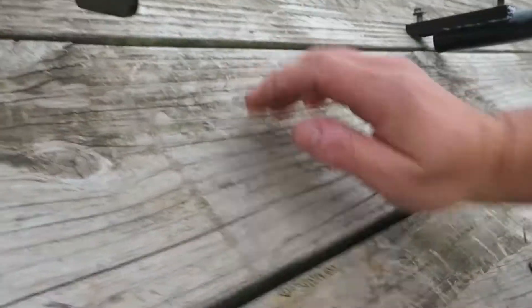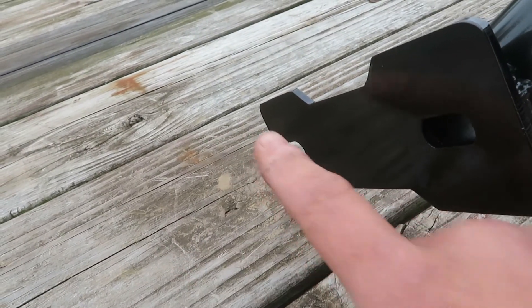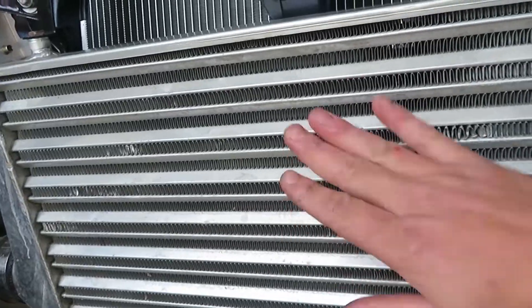The hole here is slotted and the back is slotted, so you actually have some in-and-out movement. That just happened to be enough for me to clear my intercooler with just a little bit of tweaking - extremely happy about that. But that is something to note: if you think you have a really thick intercooler setup, or oil coolers mounted in front of your intercooler or something, just consider it. Due to the slope of the bash bar the jack point is going to curve toward whatever's up front.